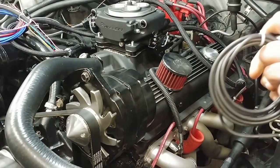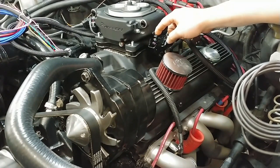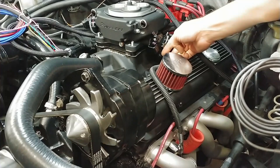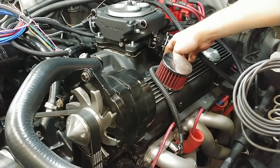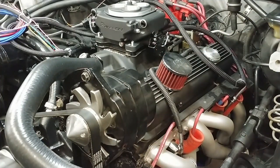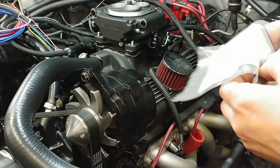And I did find out before we pulled off the carburetor that when we had the gas pedal pushed as far as we could to the floor, the TV cable was at full travel. And so we were missing about another probably 20% of cable travel on the accelerator cable. So I found this kit on eBay. It's a Sonax part, AS1-01K, and what it is, it's a little